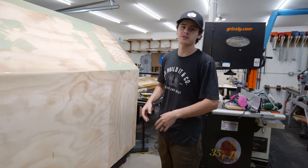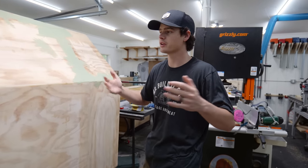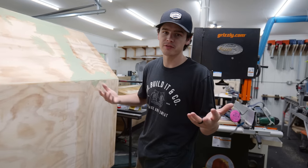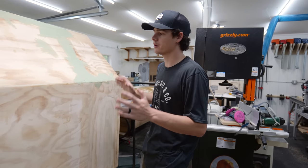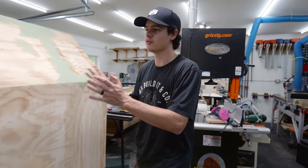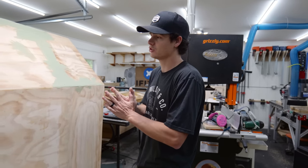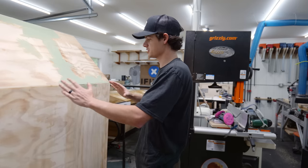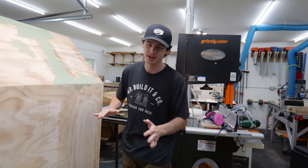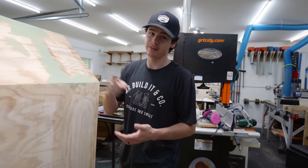The funny thing is, though, is that we're doing bed liner. So bed liner is a heavily textured product, and it hides stuff like this really well. So I'm kind of going real overkill here, but I'm also taking this opportunity to learn about fiberglass as I go along to improve those skills. So there's been a lot of work in just tidying things up and getting ready to apply primer, which will happen in the next video.